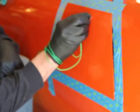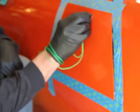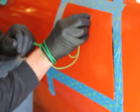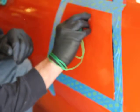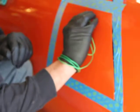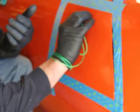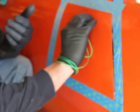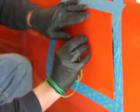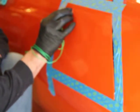So I'm just going around and hit it at a couple different angles, look at the body line and see where I'm at. You don't want to cut in because then you've got a bigger problem. But if you use this Festool, and it's really easy, I'm using real light pressure. So it just takes these little guys off. Just be patient. Take some little dust nibs off of there. There's a little bit bigger one here.